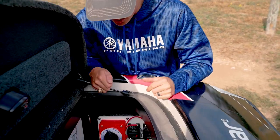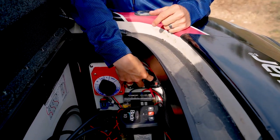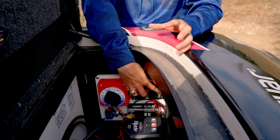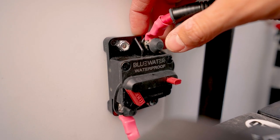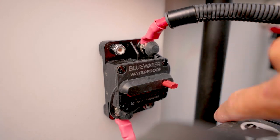If you're out on the water and something isn't working — your electronics are turning on and off, your shallow water anchors won't go down — something might be tripped, and that thing might be your breaker. A breaker is basically an oversized fuse. We have two breakers here for all of the dash and fish finder electronic systems, and one breaker on the other side of the boat in the back for the trolling motor. If something isn't working, the first thing you should do is not get frustrated — open the compartment back here and check that the breaker is not tripped. Here's what a tripped breaker looks like: that little tab is down, and to reset it is super easy — you just push it right back up.